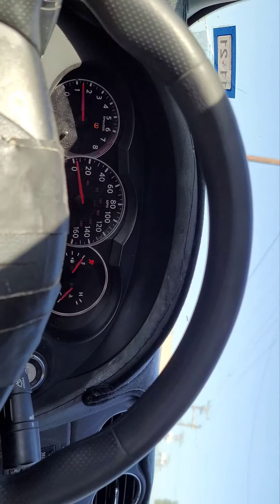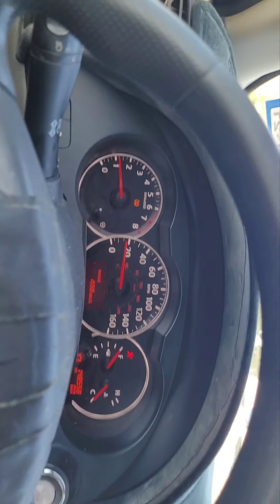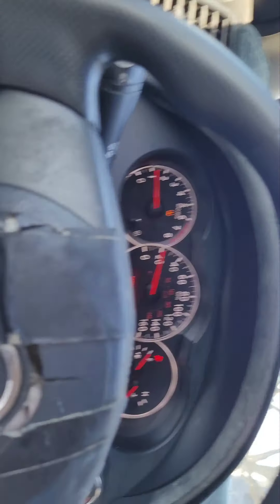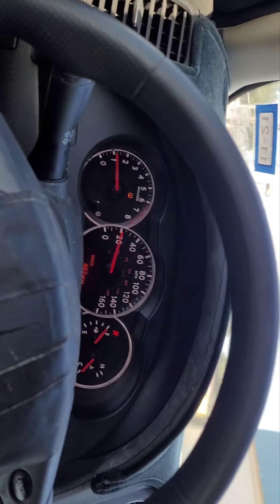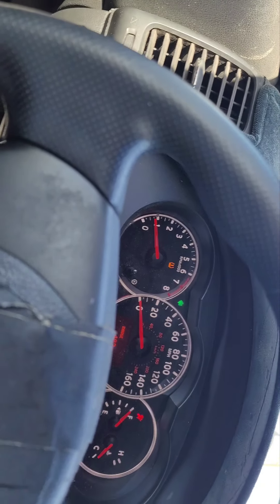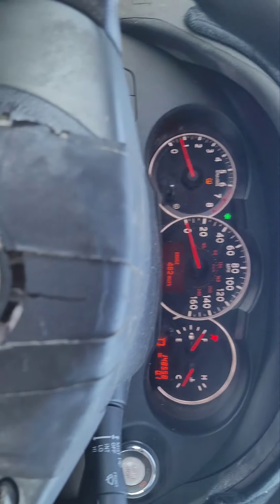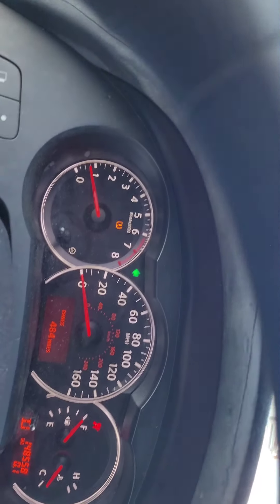The car hasn't been hesitating, but the check engine light has been on because it says the catalytic converter is below threshold — the P0420 code. I had that looked at a couple months ago and they said nothing was wrong with it. We put a fuel cleaner in the gasoline — about 20 bucks — drove about half a tank, then filled it up. It's supposed to clear that P0420 code. We'll see if the light comes back on after driving 20 to 30 more miles.